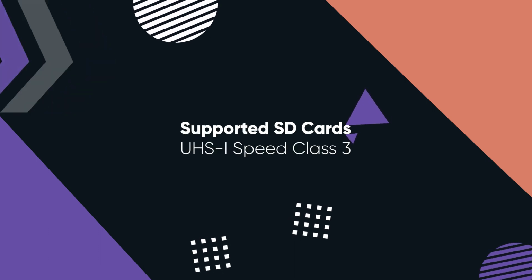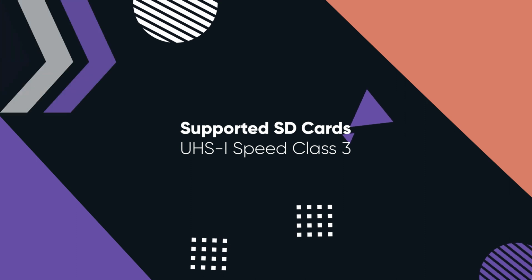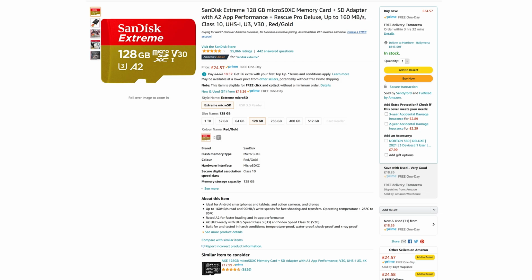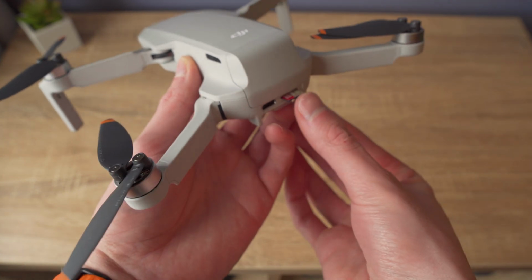For this drone, you need a UHS-1 card, which stands for Ultra High Speed 1, and you need a speed class of 3 or above. Something like this SanDisk Extreme 128GB will work really well, and I find usually 128GB is more than enough for one day's flying. To insert the memory card, simply make sure the memory card graphic's up and push it into the slot.